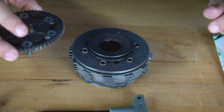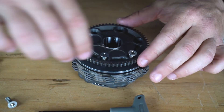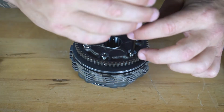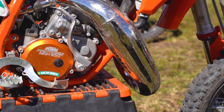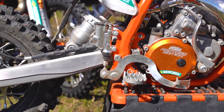Put them back just like they came out and use your new bolts to tighten everything up. Make sure you pay attention to how it comes apart so you can get it back together without any hassle — remember, the washers oppose each other. Once you have changed out the beveled washer, you will find your clutch will be back to like-new condition.